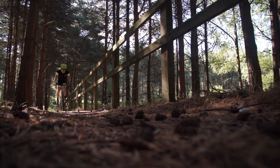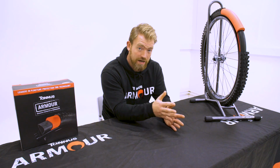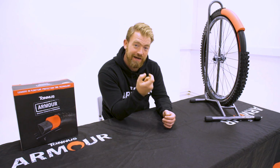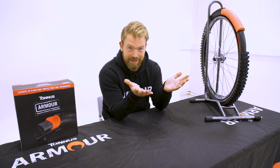It's really difficult for riders to be able to get the right PSI on a tubeless setup in gravel because we're riding more and more aggressive trails now on gravel where we actually want to use lower pressure to get more grip, but then you're burping an awful lot on a narrow rim. So this product, fitting inside a gravel bike, offers the grip without burping, with the puncture protection.